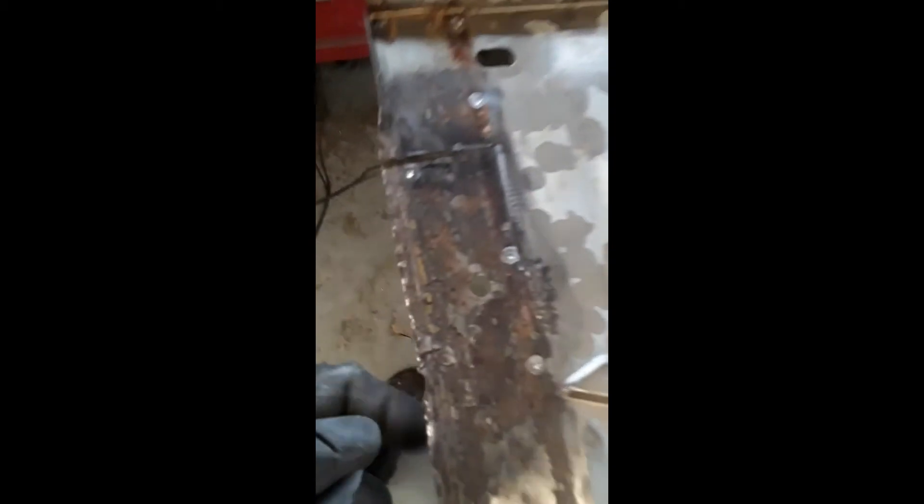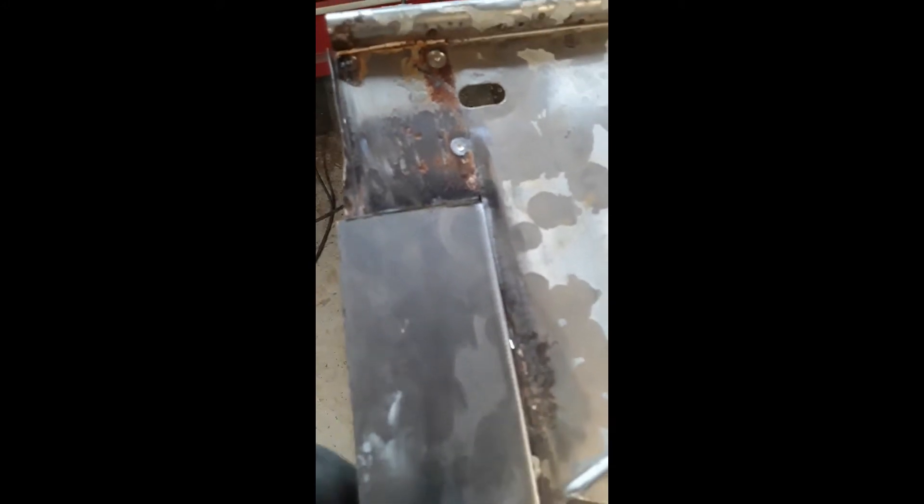These little sections don't fit in a folder, so I've bent the seam back on the bottom to have another look — just getting more and more scared by the minute. Just when I thought I was on a home straight, not looking too good. So I used to cut the damage out, then try and finely tune the panel, hold it there and weld it — but the first tag it moves. So this time I just cut a slice through and started to cut down, but I've left the old panel behind, so it's actually supporting the repair panel quite nicely.